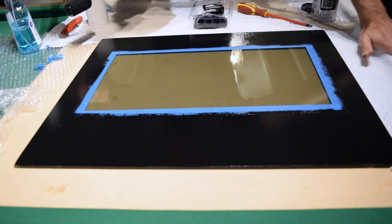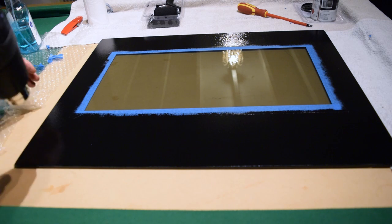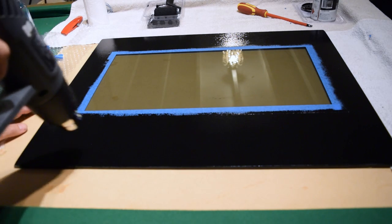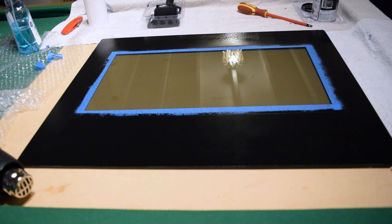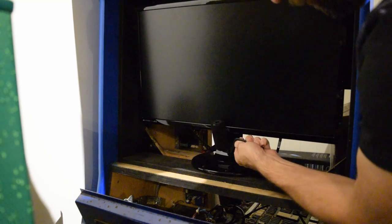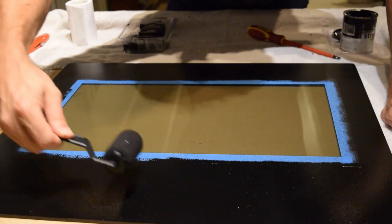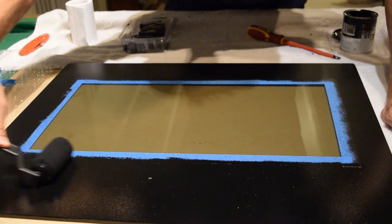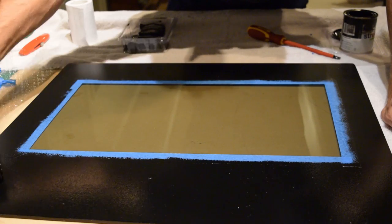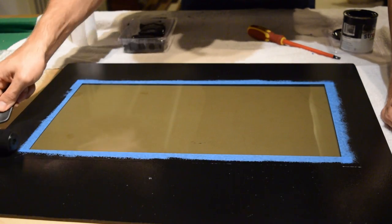The edge of the glass is the bit that tends to miss the paint the most. This is where I am impatient, and I want to do this very quickly, so I'm going to get this dried off with the heat gun. While I let that sit there, I'm actually going to move over and paint those little bits of the screen that we could see — the name of the monitor and things like that. This doesn't have to be anything particularly fancy, just trying not to get paint on the monitor itself. This second coat — it's not like a second coat on the side of a house. You're actually not going to see the second coat because it's on the inside. This is really just going to fill in any little gaps or any thin parts of my paint job.